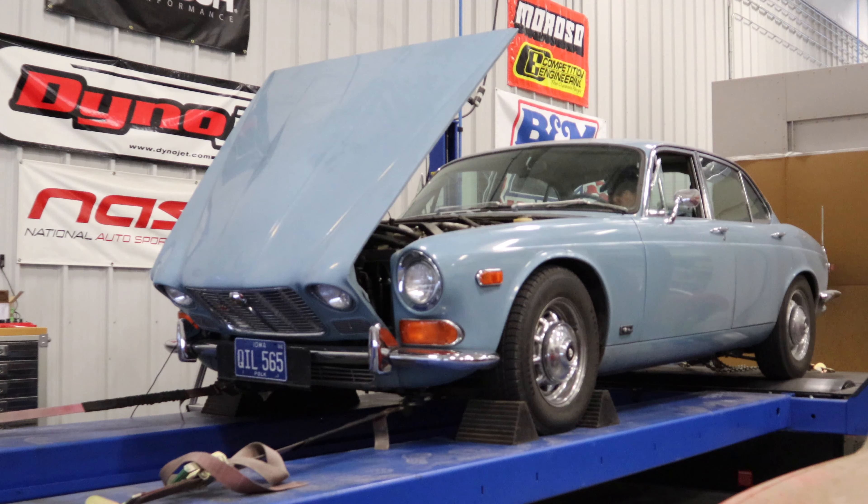We did gain a couple horsepower this time, but we're still breaking up in RPM around 3000 RPM. The next thing I'm going to install is a new cap and rotor — I'm going to do both of these at one time. I don't like to mix and match these just in case there's a clearance issue, and I only have one each of the new ones, so I'm going to install both at once.